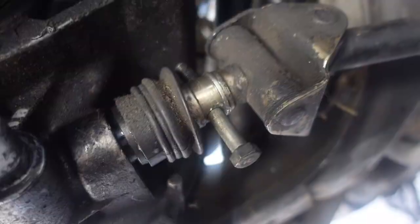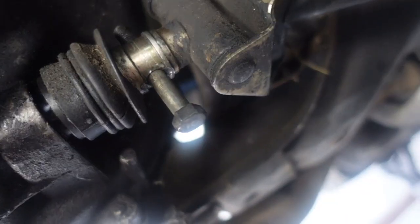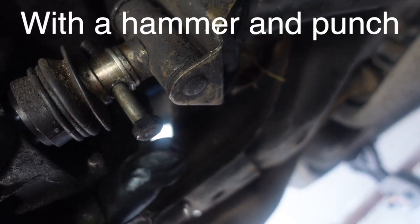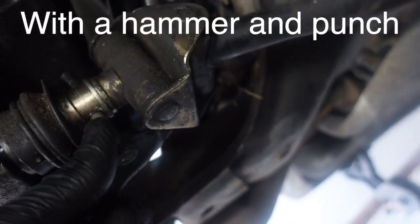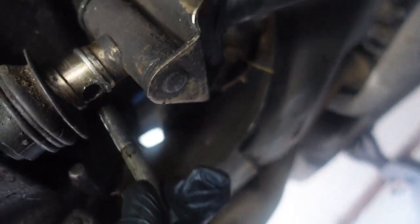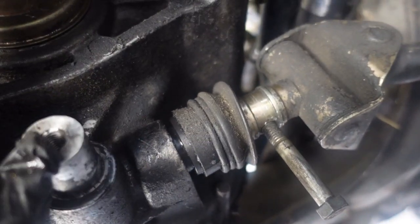Behold the bitch pin. This little teethy little chewer — I thought it had to be pounded out from the top, it definitely doesn't, you can pound it out from the bottom. I smacked the edges of it a little bit because it was a little mushroomed out, so I smacked them in a little bit. Then this bolt right here is the perfect fit to go in here and push the pin out — and it's the bolt from this shift linkage.